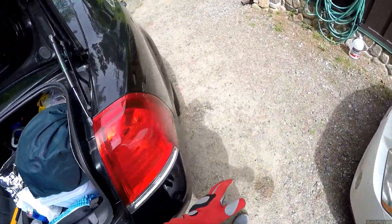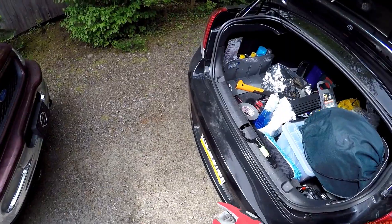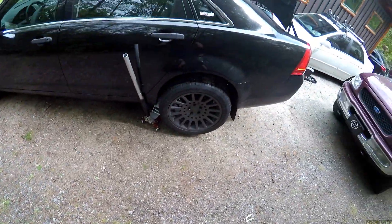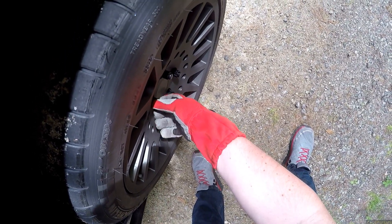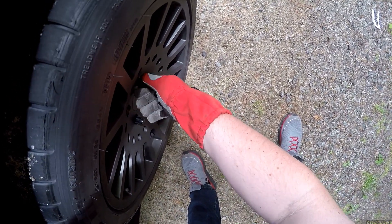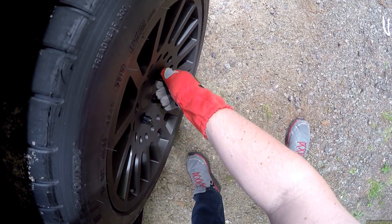The suspension helped, but the tires stick out a lot. I'm getting a little rubbing here and the rubbing is not going to go away with the spring constant change, but the ass of this car is so big it just needs to be dealt with. Big fat ass on her. Long wheelbase G8, essentially a Caprice. I've already jacked it up and broke these off. GM actually flushed my brake — they took off these tires and then didn't tighten them very good, because I had no struggle taking off these lug nuts at all and they're supposed to be torqued to 140.